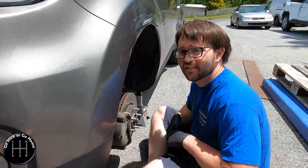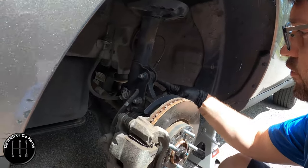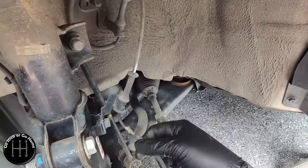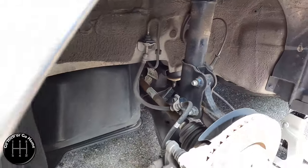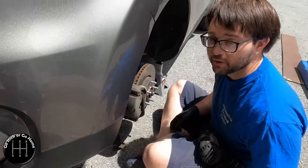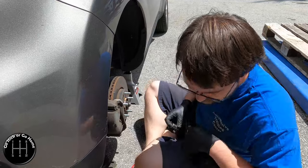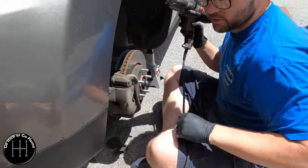This has been really easy. I guess that's the difference when you work on 20-plus-year-old cars versus something that's only four years old. Down here we're going to get this strut out. We have to take the two bolts off mounting it to the knuckle. There's a bolt for the brake line bracket, one for the ABS sensor, and one bolt for the link. Other than that it's just the three at the top - it's a 14, a 17, and a 12. For pretty much all these bolts so far it's basically been what I'm going to call Honda sizes.